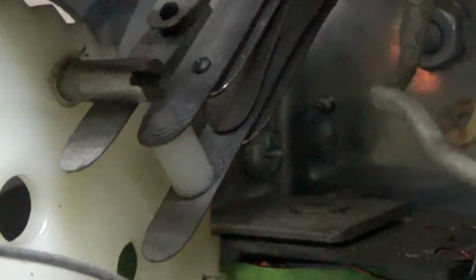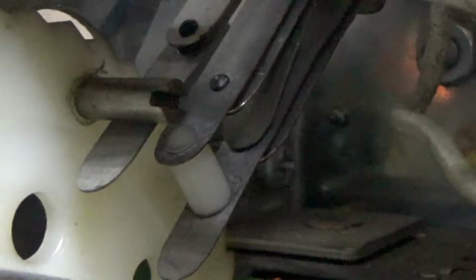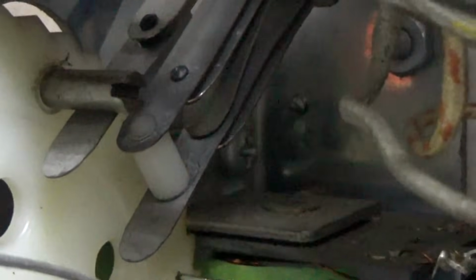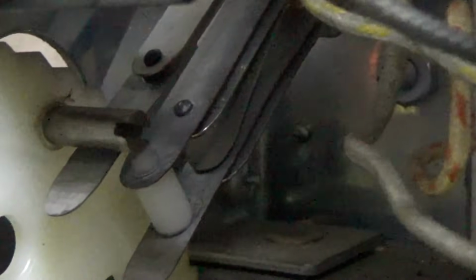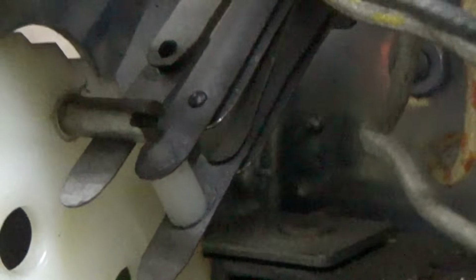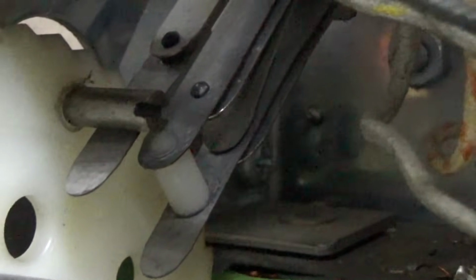One of these 2 switches, if it opens at 0 when you have 0 credits, that's why you can't start the game. As long as that switch stays closed, you can start the game over and over and over again. So that's how you put it on free play. You make it where that switch doesn't open. You can do that a number of ways. You could put an alligator jumper on the 2 blades back there. You could bend it out of the way where the little plastic post down there can't hit it.